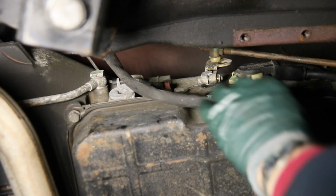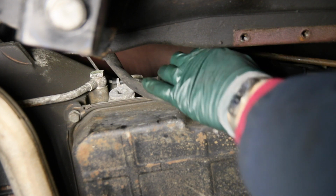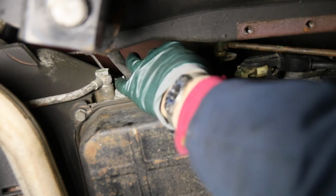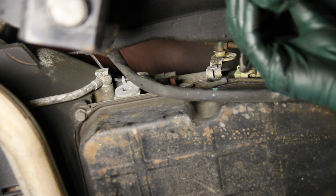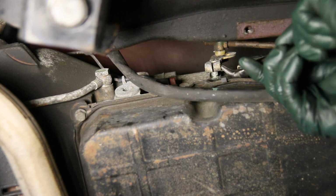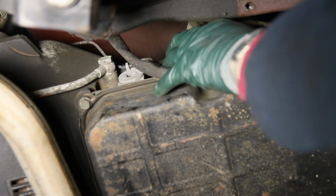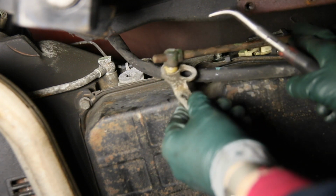All right, you can see the bolt there in the washer. I'm going to push the bolt back. The bolt has to come completely out because there is a notch right there in that shaft going into the transmission. Okay, the bolt's out. And then let's see if this will pry off without having to get it spread. Yeah, there it comes. Okay. Then just pull the whole thing out with the rod.